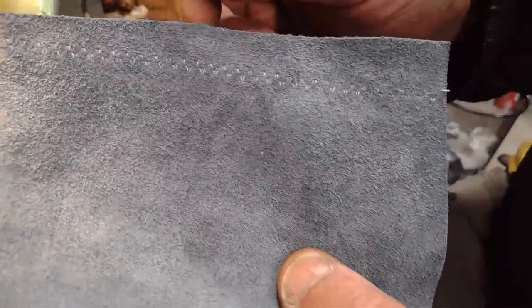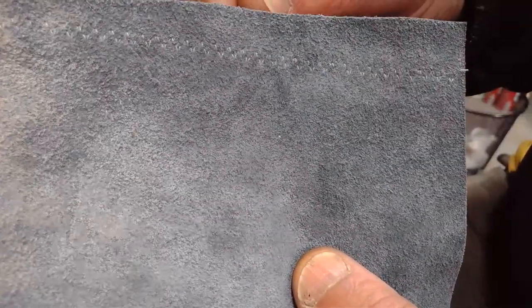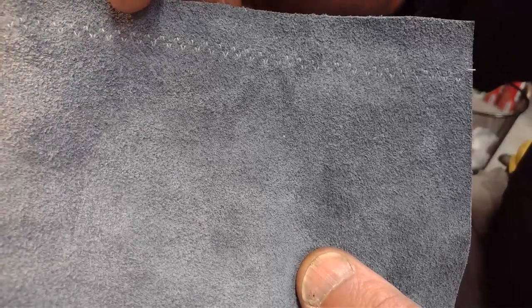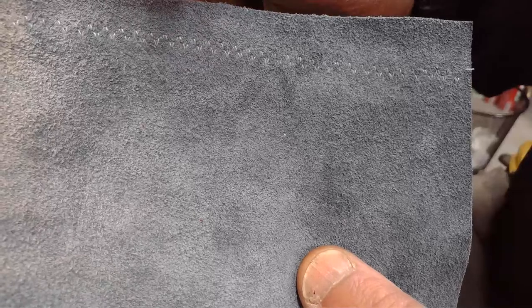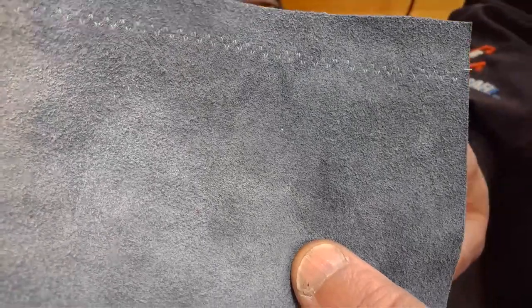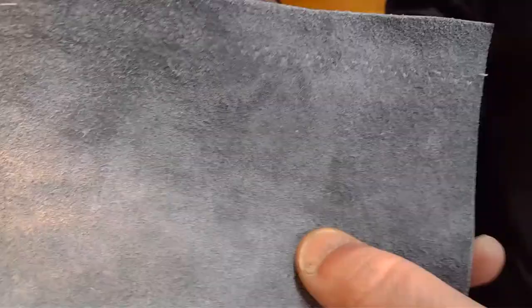Now we just did an ornamental type stitch in position 1 on the cam stack. And we've got beautiful balance. We started a little bit too snug, and I kind of backed off that upper tension a little bit so we would still have a very nicely defined lock stitch, but not overly poppy. See if I can get a little bit closer and kind of show it to you. Hold on. Assuming the camera cooperates.